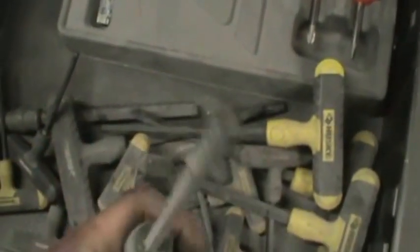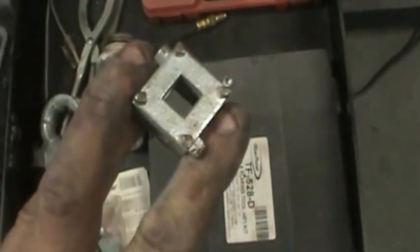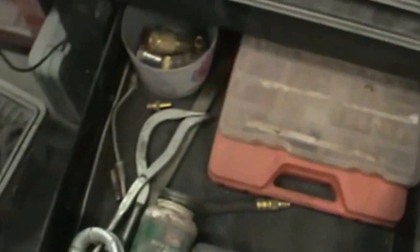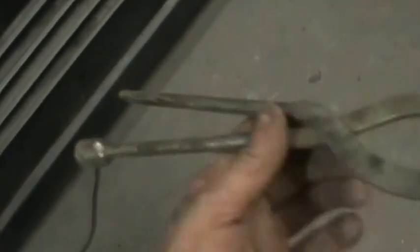The screwdriver drawer — everybody's got one of these. I don't use these near as much as I thought I would. The brake drawer: I like that guy, he's handy — that's for your rear calipers that twist in because they are the emergency brake also. Double flaring tool, various fittings. That's a drum spoon — to be honest, I've still never figured out how to use that blessed thing; I use a pair of channel locks and a screwdriver.